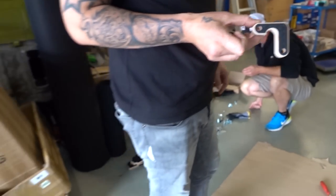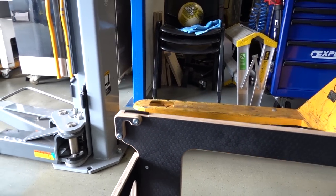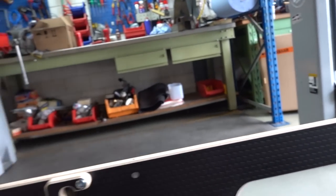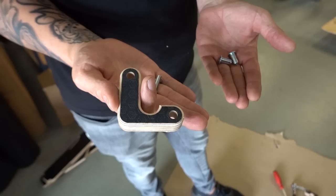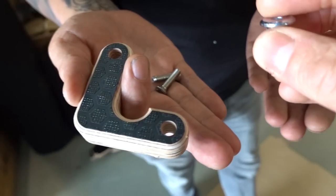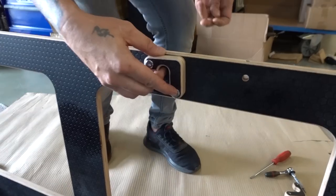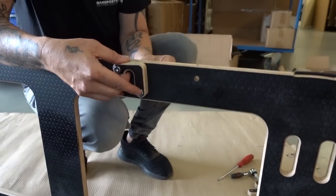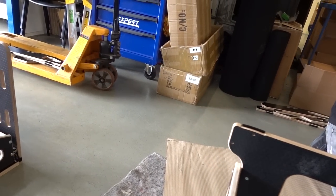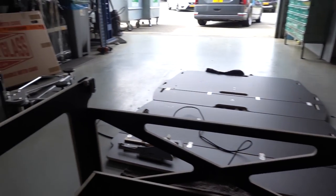You should get four little hooks. If they're not pre-installed, you've got two each side - that's the shape and angle they should be in. They're there to allow the top, when it's on, to lock into various different positions and stop it from moving around. There are two on each side - two at the very back and two towards the front. The fitting has changed slightly now - you're using the shorter screw and these female nuts. The female side goes into the textured side where the hole is, and then use the male side to lock it in place. Use a 4mm allen key for both, then repeat on both sides and also on the back.